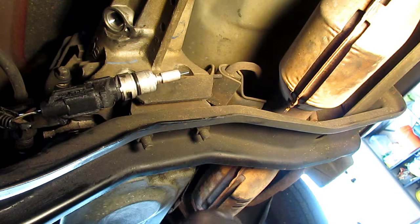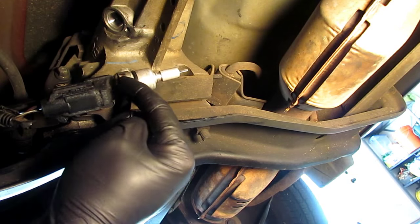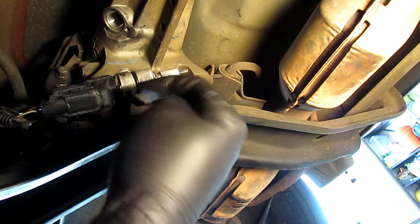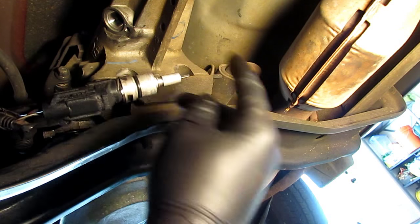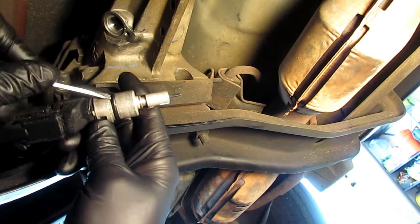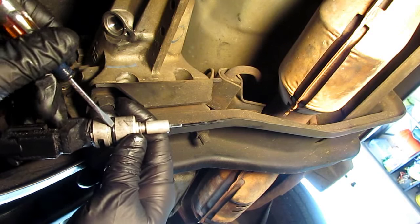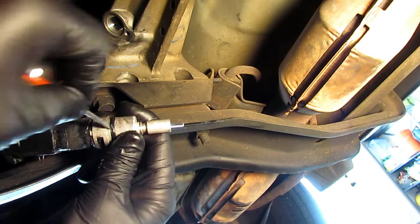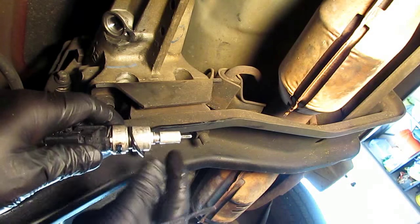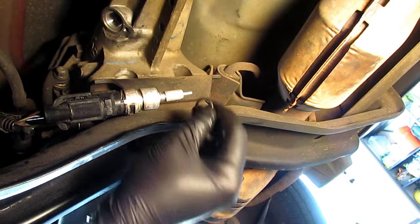That's the old gear. When you pull this out, make sure you wipe all the grime away around the o-ring area. There shouldn't be any grime inside since it's been sealed in the transmission, but there will be some on the outside, so wipe that off before you stick it back in — you don't want to get junk inside the tranny. Take a hook or your screwdriver and pop that old o-ring out, then put your new one on without breaking it.